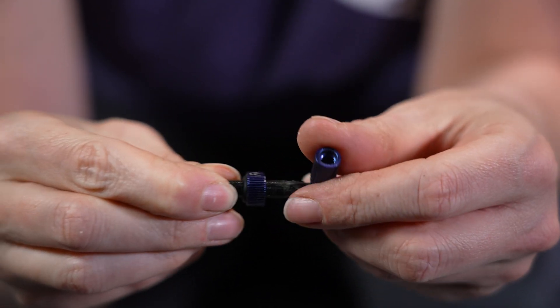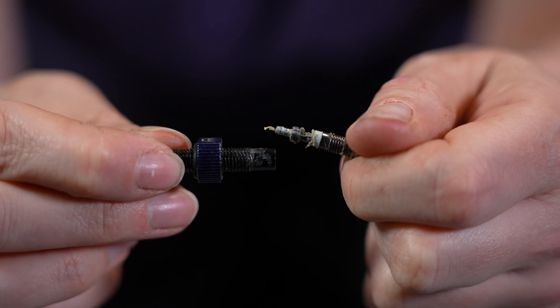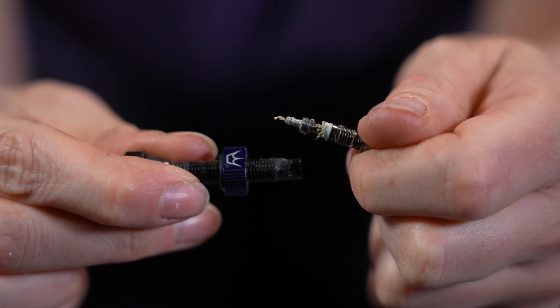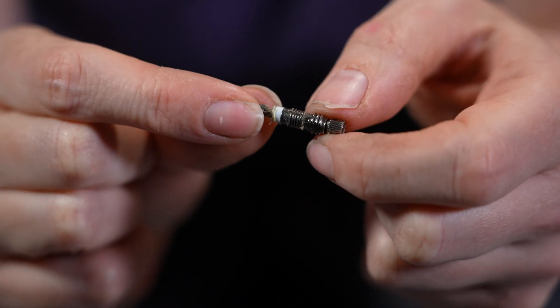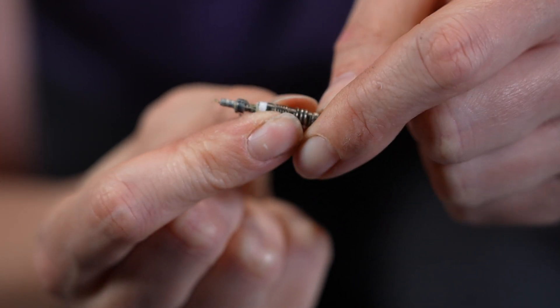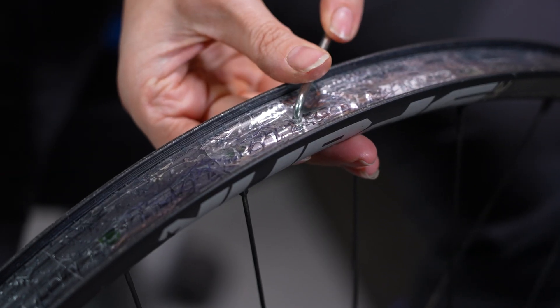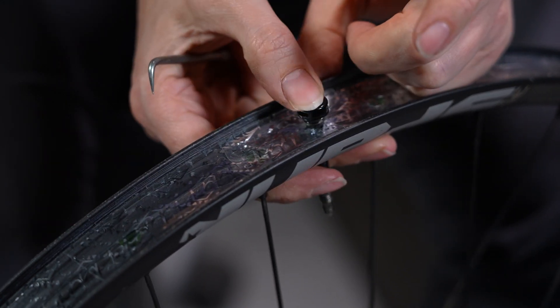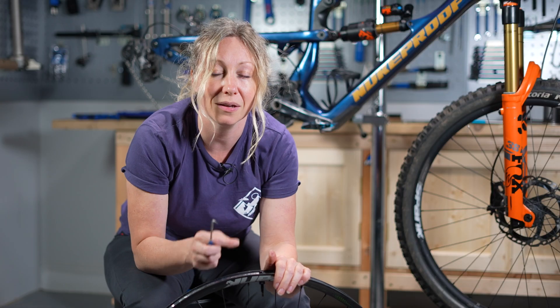If you're sticking with the same valves and not replacing them, then check your valve cores — are they moving slowly, letting air in and out too slowly? It could be that the valve cores are a little gunked up and you might need to take them out and give them a really good clean, pulling all that dried-up sealant off, or maybe even replace the cores themselves. My big tip here is to stab a hole into the tape rather than cut it or cut across, because you want minimal damage to your tape. When you put the valve in, give it a good push from above so that the rubber piece compresses and you get a really tight closure from the nut on the other side.